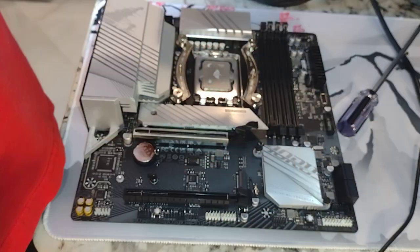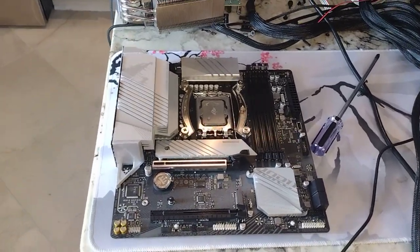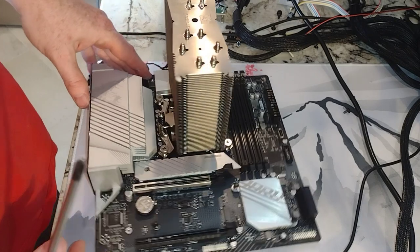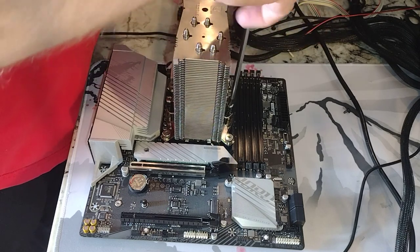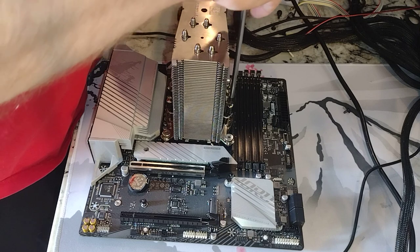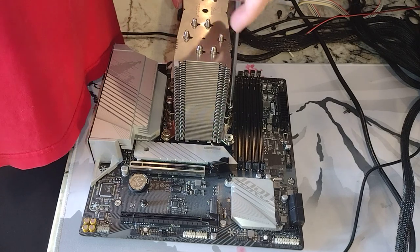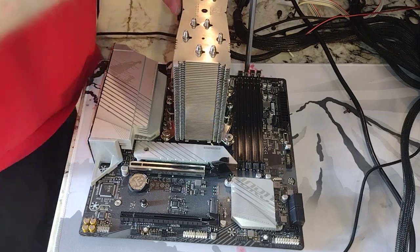CPU cooler — I have a couple of these. The tower is actually kind of tall, so I'm going to drop this in, hopefully lining it up, and we just want to get a couple of threads on each side before we start cranking down. Alternating sides, this is helping to spread the thermal paste evenly, filling those gaps, hopefully allowing us to get the best thermal transfer we can get.